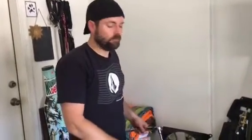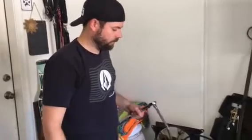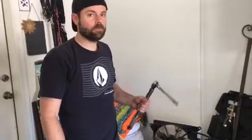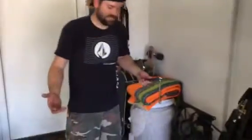Alright, so basically we had to put the phone down just to get the valve body pushed in far enough so we could get all the bolts threaded and seated properly, so we didn't have one side lopsided. So all of those are kind of snug fit now, and we have to go back around. There's 20 of them. We've got to do 7 pounds of torque to tighten them down. So that's what we're about to do. I'll take you through a couple of them.